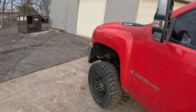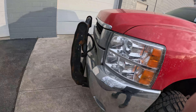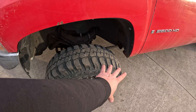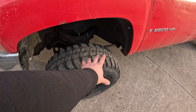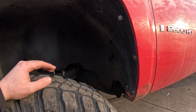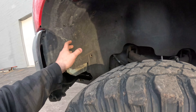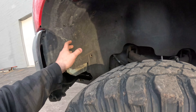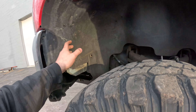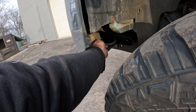Basically we're going to be replacing the fog lights. They were working fine, but this one does not work anymore, and I'll show you why. See this tire? This tire picks up stuff off the road — moisture, snow, salt, slush — and throws it around. Now in here we have a splash shield or inner fender, whatever you want to call it. When I put the 24x14s on, even with the lift kit and the torsion bars cranked all the way up, it still catches it, breaks it, and rips it off. All that debris the tire throws up hits the fog light, and these fog lights are not waterproof — they should be, but they're not.